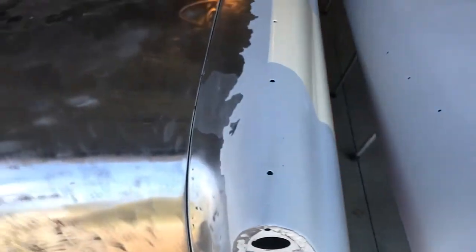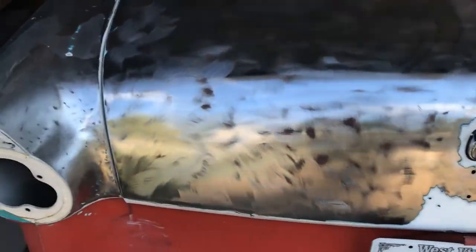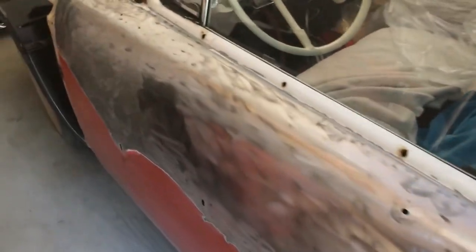This just needs to be spot sanded a little bit. It is super slick — it's real straight. Stripped all the paint off of here. A lot of Bondo in places; they used glaze almost a quarter of an inch. I don't know what they were thinking, but stripped all this down here. All those dark red spots are actually red oxide primer — they're not rust.